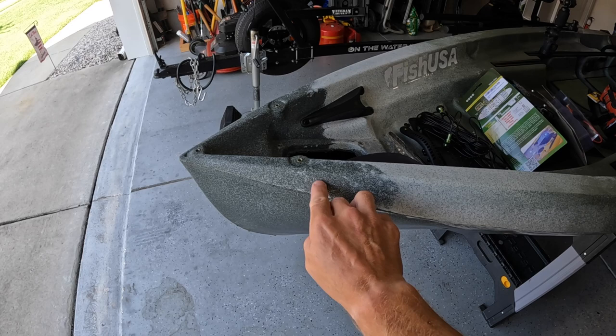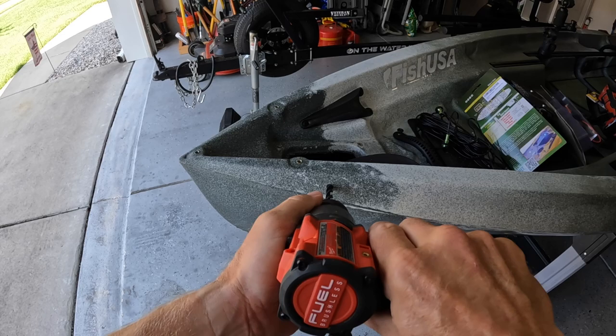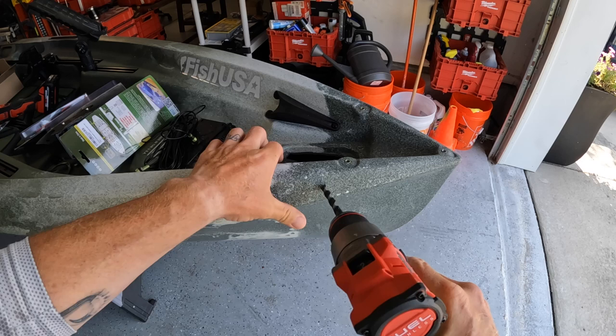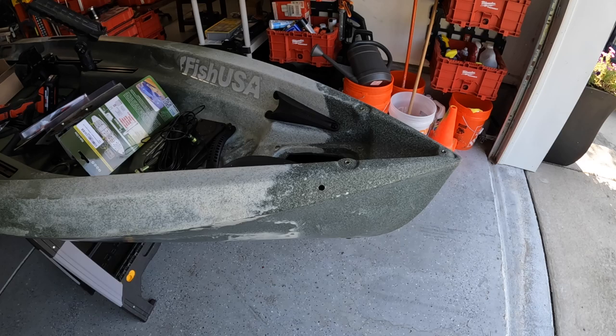So we're going to put them right here. You can see it's a very small hole when you drill through — don't go flying through because you can come out the back side of your boat. Just get it in there, penetrate this a little bit, and go through really slow. Just go in a little bit so you don't come out the back side.